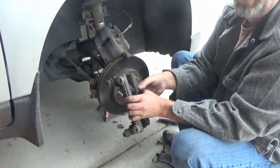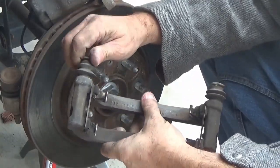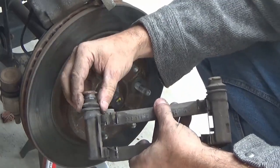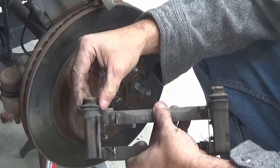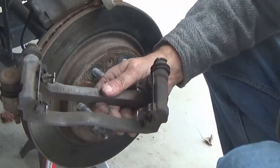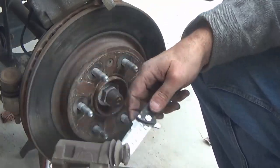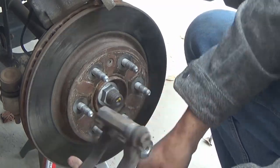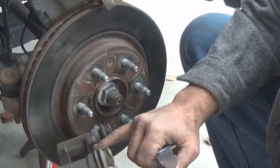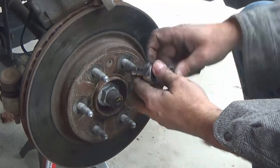There are the bolts and here is the caliper bracket. You can see there are some plungers — those plungers need to be loose and free to float back and forth, because that's what allows the brakes to self-center as they wear. Make sure yours are nice and free. Then you can pry off the brake pad hardware since we're going to put on new hardware. I'm using a knife to scrape off the rust and corrosion where the hardware sits.